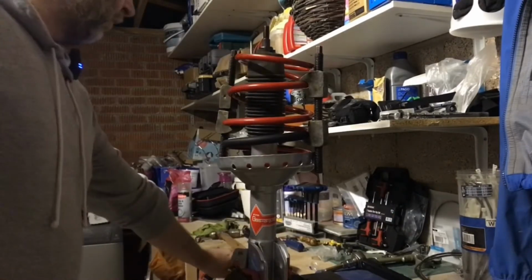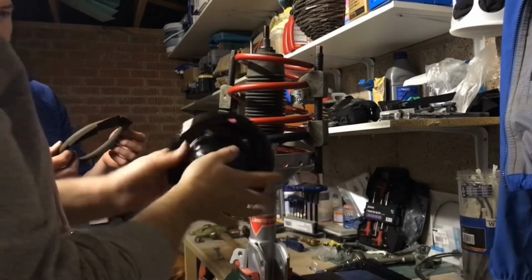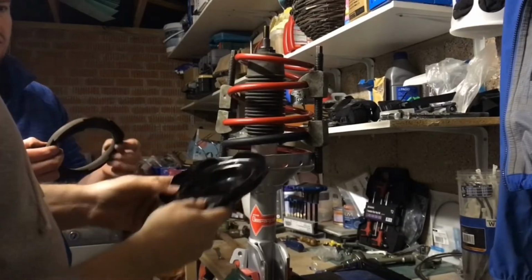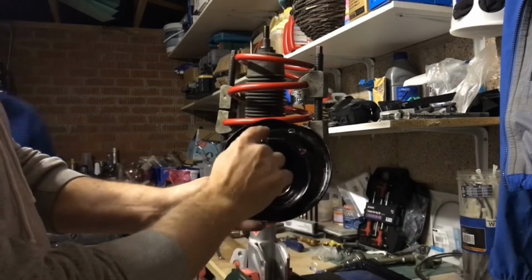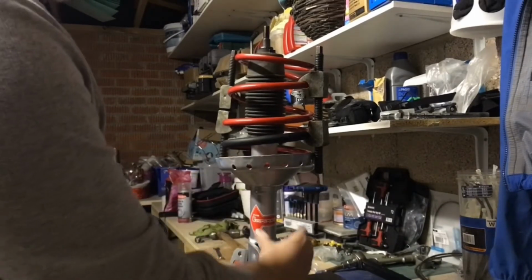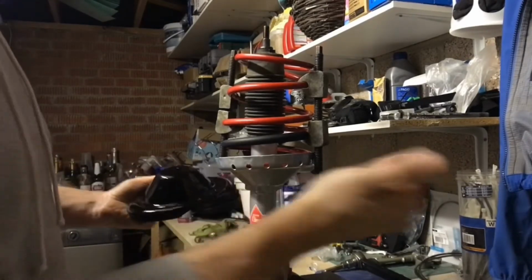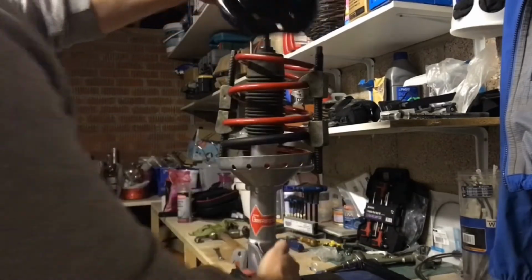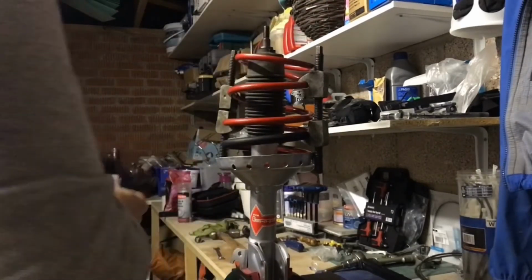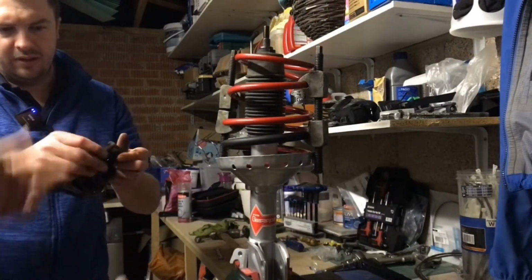Then with your, I don't know what this is called, spring top mount plate, whatever it is, with its rubber insert, you need to make sure that the 3 holes here sit aligned to the 2 lower mounting brackets. So in theory, they're facing outboard of the car. So they need to sit, this is outboard, they're going to sit like that. So when we put that in there, Jamie's just going to put the rubber insert in there to make sure it all aligns as well.